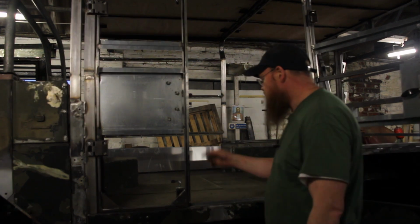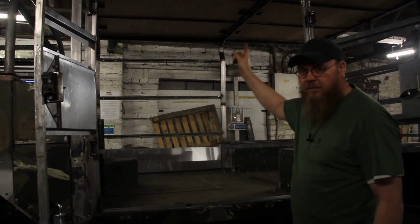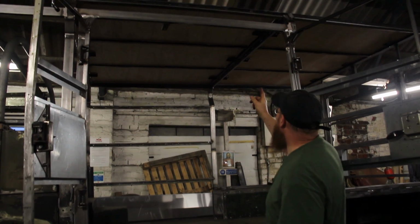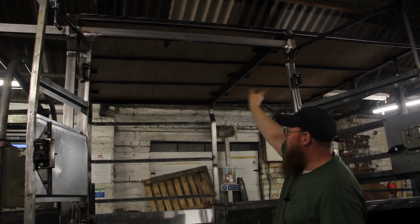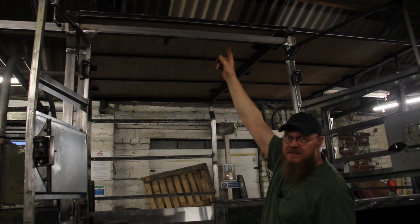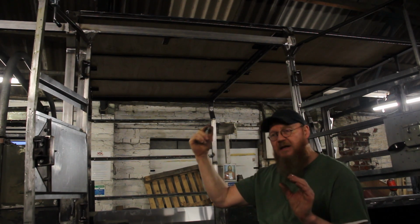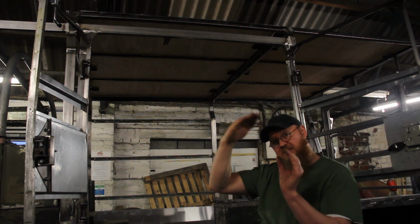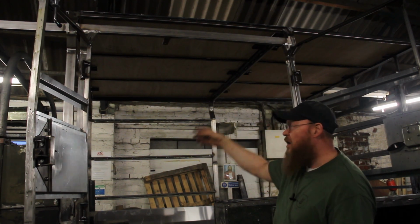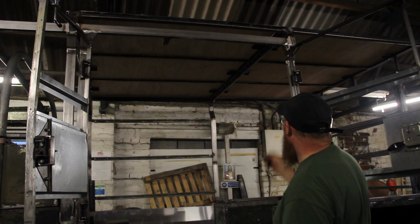That's that. The woods, let me just open this, might be able to see it a bit better. So the roof, 12mm ply. What I did was I put some lugs in between the longitudinal braces, which I put in. So brace the set those there, and the ends, because the box section at the top is on an angle, the top face of it is angled, so what I did was I mitered the actual ply board to match that angle, and then I've glued it all down. So I've etch primed the steel, and then glued it all down, and then it's screwed down, so it's glued and screwed down, and that's for both of them.